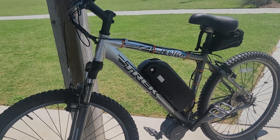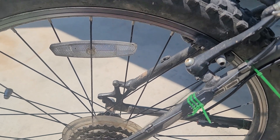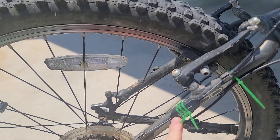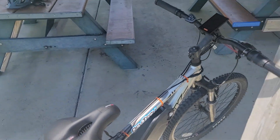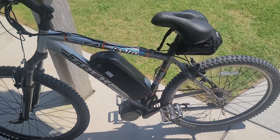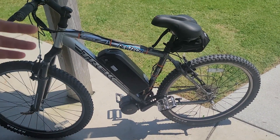These are kind of on-off style brakes. A lot of people asked me if you need a gear shift cutoff sensor. I did install one because Johnny Nerdout said to go ahead and install one. This works fantastic for commuting or riding on the road where you're not under a heavy load, but it's not going to save your butt climbing up a mountain trying to shift to a lower gear. Your best bet on these builds is don't shift at all when you're on the trails under load. Just don't do it — you could throw your chain, break your chain, cause other damage. Put it in your lowest gear, cycle the crank, and let the thing pull. But out here on the flat, that shift sensor works great — it senses the cable moving and cuts the power for a second until the cable goes back to its place.